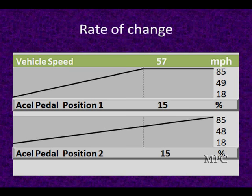Here's two more. This time we used a scan tool. We always graphed accelerator pedal position when we used scan data, because we get a picture here that wouldn't make a lot of sense if we looked at it numerically — it just wouldn't compute. You'd see numbers changing and they wouldn't be the same.